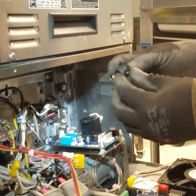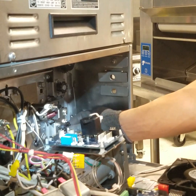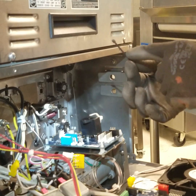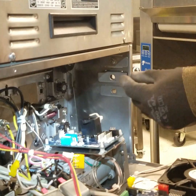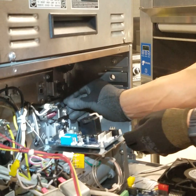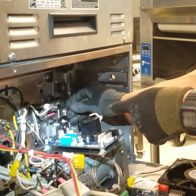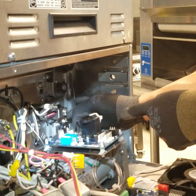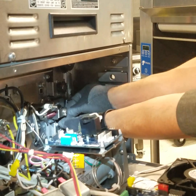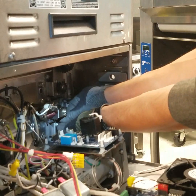Reinstall the lower drive sprocket without the set screw. Install the set screw on your 3/32 Allen key and locate the dimple hole in the shaft with the hole in the sprocket and tighten the set screw until snug and tight.